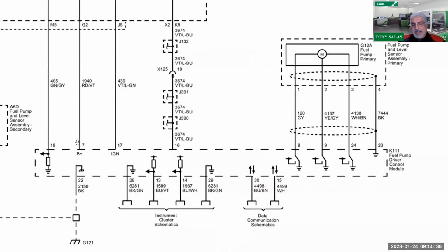I could see, and I haven't seen it yet, don't get me wrong, but something we got to understand is that a lot of guys are going to disconnect the connector and go ahead and measure those voltages right there. And that's what we call open circuit testing. That's nice, but that does not have any current flow through it.